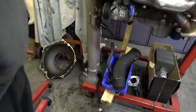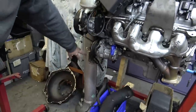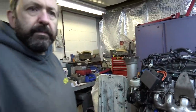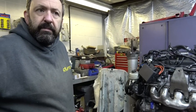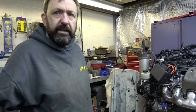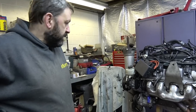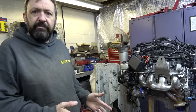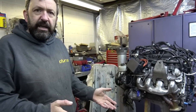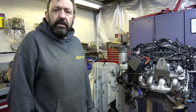That's the torque tube. Basically it bolts onto the engine, the torque tube runs up the middle of the car, and then the gearbox and gear linkage are at the side. The clutch goes on the engine — so that's traditional. Why would anyone have this layout? A lot of it's weight distribution — ideally 50/50 on the car. It's also space and packaging. A lot of TVRs, being small cars, end up with no leg room at all with a gearbox in the middle. With this setup, you still have a full-size cabin with a foot rest.